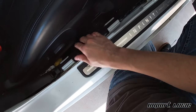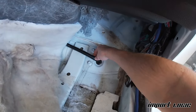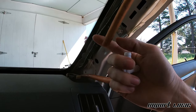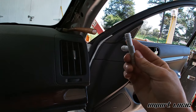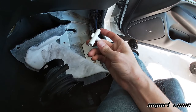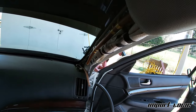I pulled the trim that goes across the bottom — just grab it and pull up, it comes right up. I pulled the carpet back to get a better idea of what's underneath, and sure enough there's the drain for the AC system. I went ahead and cut the hose here — this is a good point to tie into. I'll cap the old end off and tuck it in the dash. I confirmed this hose is in fact 3/8", so my 3/8" barbs and 20 feet of 3/8" line will work. I'm going to fish the new hose down the same path and see where it ends up.